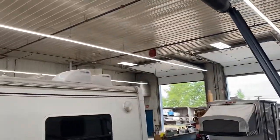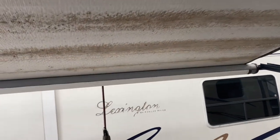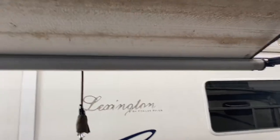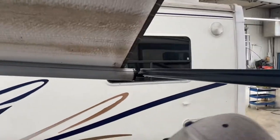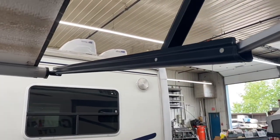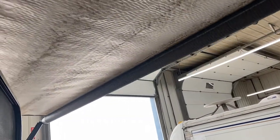For your awning, just press and hold Extend and the awning will make its way out. Once it's fully extended, you'll see a little white flap at the end fold down and the gray of the metal tube. Once you see that, stop. If it starts raining, it'll run right off, but if you want more shade, just grab either arm, pull it in a bit, and lock down on that knob — that changes the pitch of the awning for more shade. Do the same at the front if you like. Before bringing it back in, make sure the arms are back fully extended so you're not risking bending them. Also keep in mind it doesn't handle wind well — at about 15-20 kilometers per hour, you'll want to bring it back in.